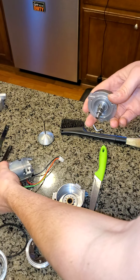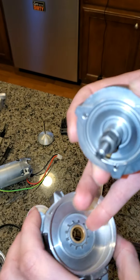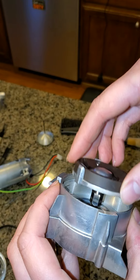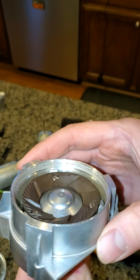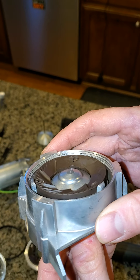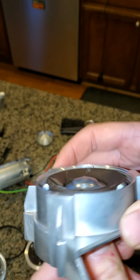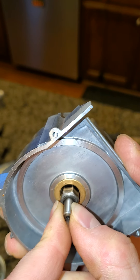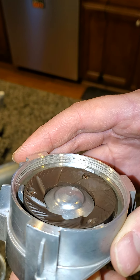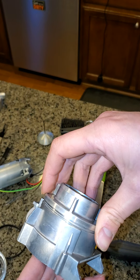There are three things holding the axle. Machining tolerances in the axle — the bearings are going to be really, really good, but the axle is not necessarily going to have a perfectly snug fit. When the axle is just in here like this, you can tilt it. I'm able to move the axle back and forth in the bearing. That obviously changes the angle, the plane created by that burr, and will cause it to be out of alignment if it is not tilted the right way.